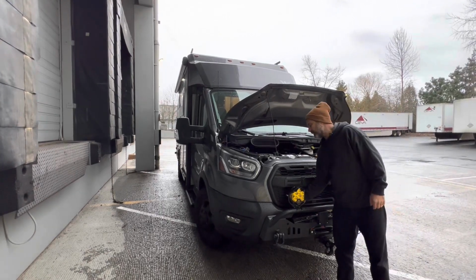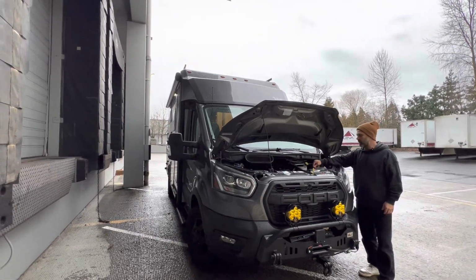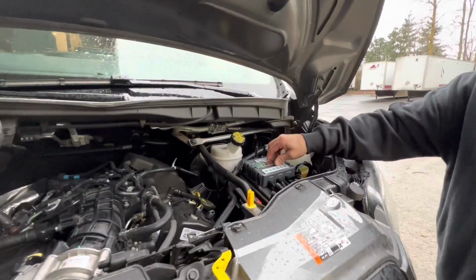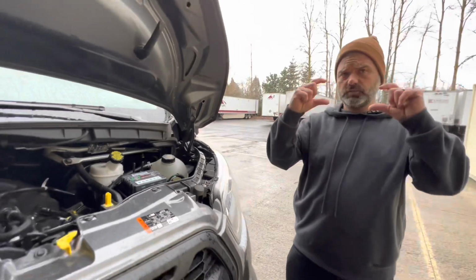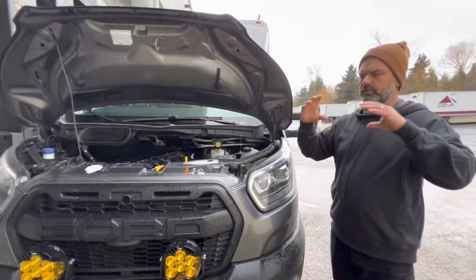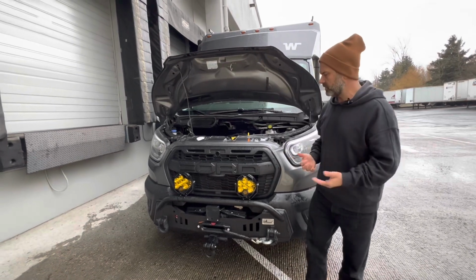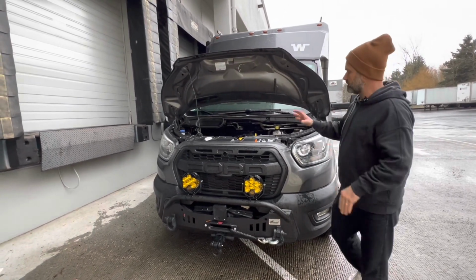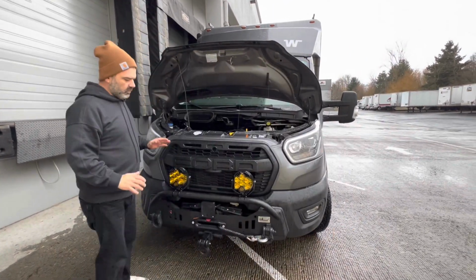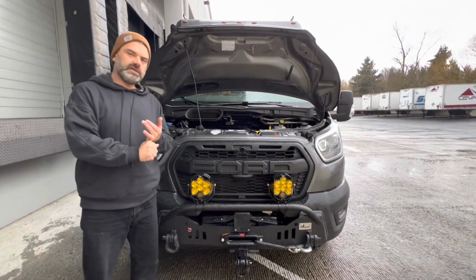We talked briefly about how we chose to wire our unit into the Trigger 6 here, which is our RF, radio frequency, wireless control unit, where we chose to mount our rocker switch panel inside, which again was what I'm going to call the bulkhead in the cab where the dome lights are located. I talked a little bit about the benefits of where I thought ergonomically it felt good. Again, you can put it anywhere you like. We talked about also that unit can be hardwired. And more importantly, I think what we really talked about is the lighting zones and where you should start with your lights. So what I'd like to do is leave you with this.